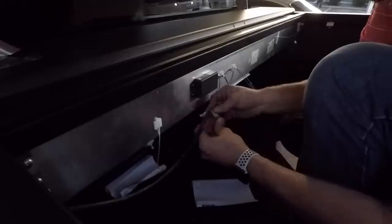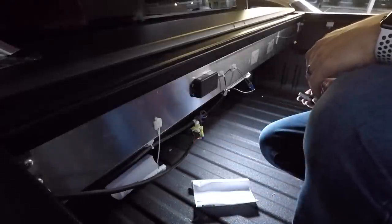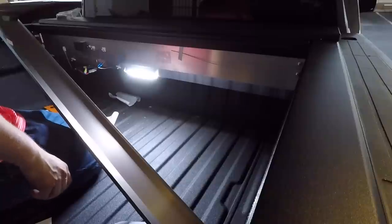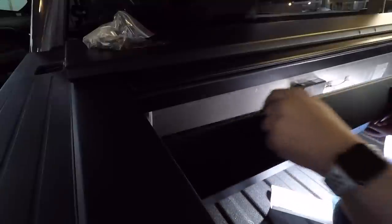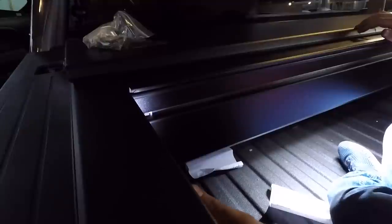This thing worked immediately after I was done wiring it — it was much easier than I would have ever anticipated. Cycle it through a couple of times to make sure the cover is working and no further adjustments are needed on the rails. Then hook up your lights, and once everything is working you can go ahead and put on your cargo shield. That is it for the Roll-N-Lock E-Series installation. It took me about an hour and a half, including filming time. Information on the Cargo Manager will be in a separate video linked in the description below.